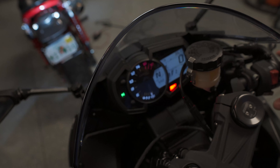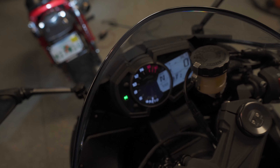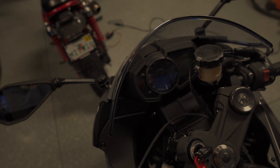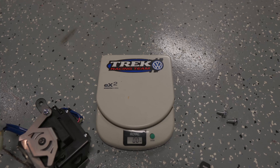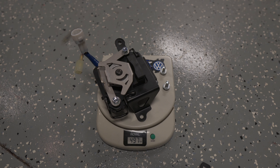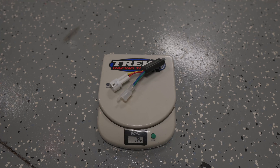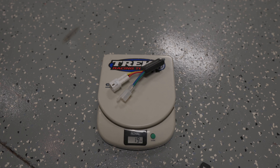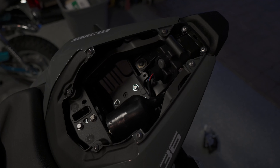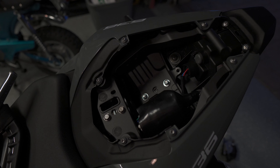We also don't get that sound of the servo motor going back and forth. Fire it up — and good to go. Obviously not a primary focus of this install, but there is a little bit of weight savings. The servo motor and the Yoshimura device combined were weighing in at about 500 grams; the servo buddy weighs in at about 18 grams, so overall just a bit over a pound of savings. Obviously not a reason to spend $50, but a side benefit in case anybody was wondering. Thanks to the commenter that mentioned this was a good option — it was about $50, Amazon had it shipped in two days via Prime, and it's a pretty clean solution to free up some space.